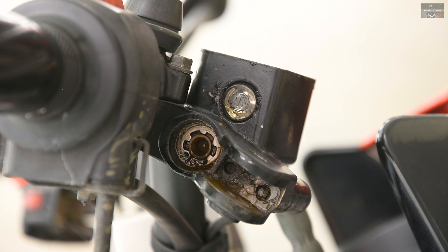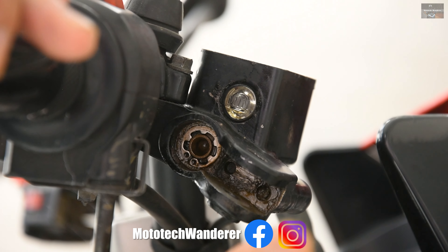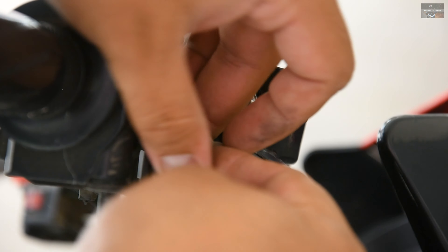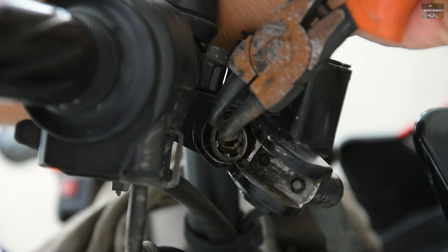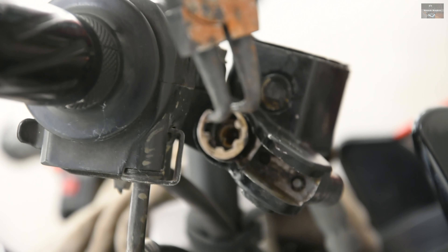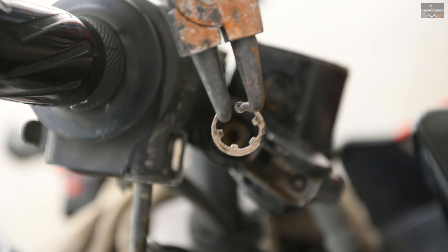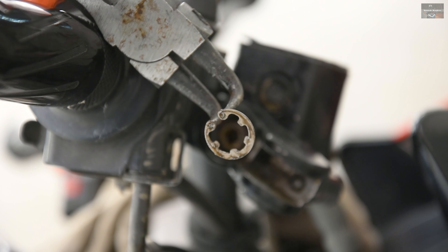This is where we would be removing the master cylinder assembly. We have to remove the master cylinder assembly because the master cylinder has leaked — the oil has leaked out and braking is gone. So we have to remove the master cylinder assembly, and we are going to use a circlip puller to get rid of the circlip that holds the master cylinder in place. Before doing any of that, we are going to wipe off any excess dirt or oil present at those locations. That's what the circlip looks like, and the circlip puller is really helpful to pull out the circlip, after which we are going to remove the master cylinder assembly, which is loaded by a spring inside.